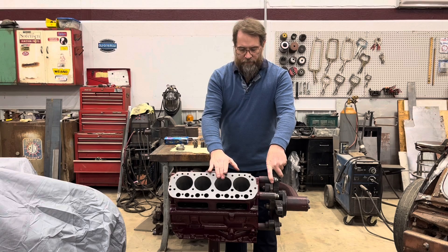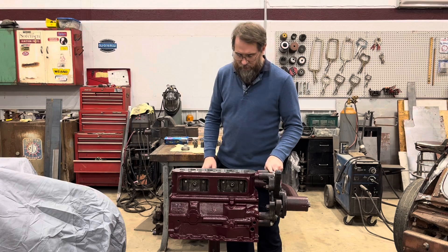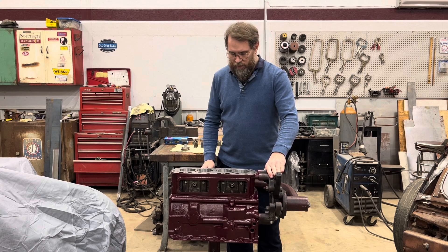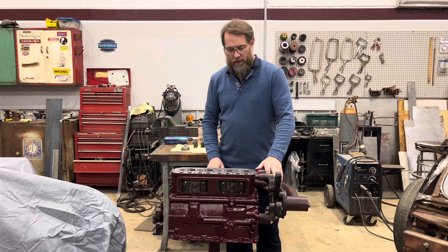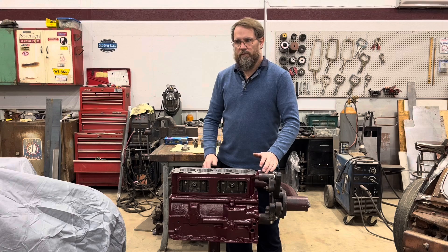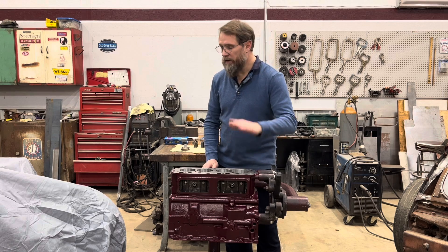It's going to be 60 over, got a wedged crank, Max Speeding rods. The compression ratio, depending on how you're calculating it on my old computer program, will be about 9.6 to 1; according to some of the online calculators it might be as much as 9.8 to 1. Got a good harmonic balancer, an APT VP12 cam, chromoly push rods, offset rocker bushings, ported head, lightened flywheel. A lot more motor than I thought I was ever going to be able to afford to build, but this money has been spent over many years because some of these parts are carried over from my last engine.